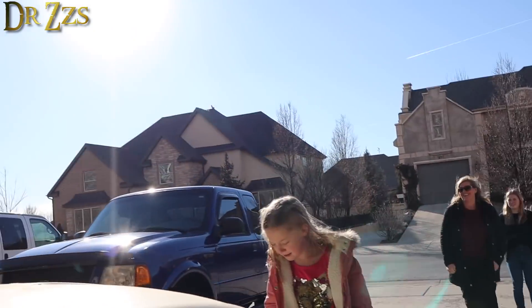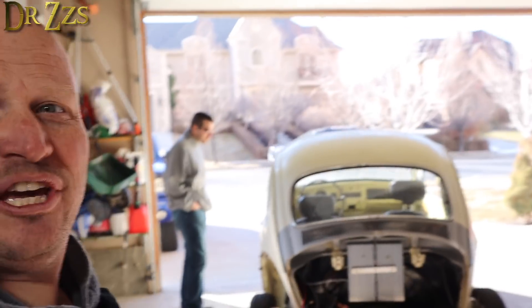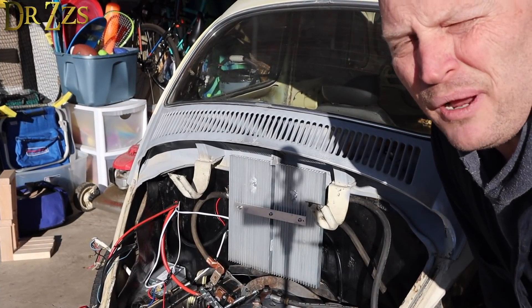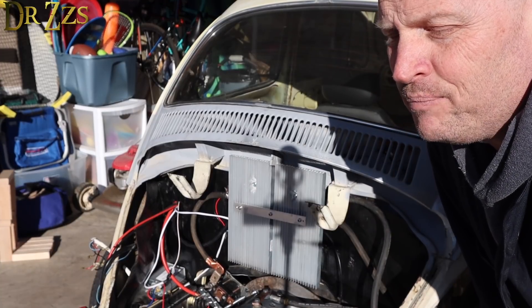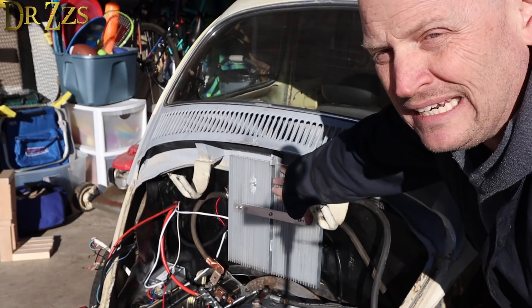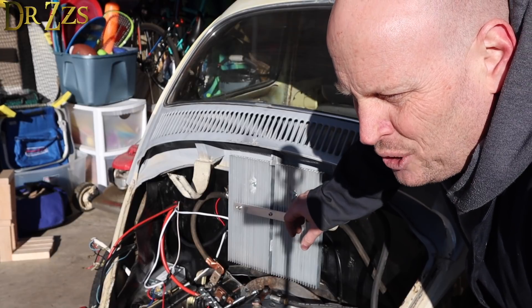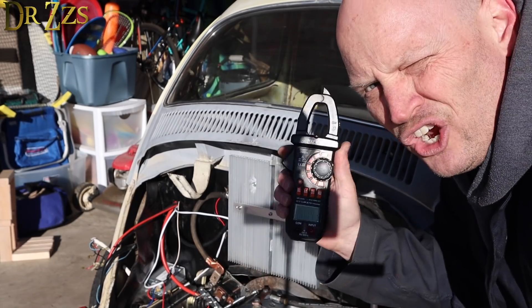And it didn't explode. We did it. So, I am concerned about how slow it was — it was not fast enough at all. In fourth gear it really couldn't get going, and in third gear it got going but we only got up to about 15 miles an hour. I have an assumption about what the problem is with the speed. The motor controller has a current limiter. I think the weight of the car has increased the demand of the motor enough that it's reaching the current limit of the motor controller. So I'm going to take the motor controller off, play with that dial on the current limiter, try and just turn it up all the way and give it another run. We also have an amp meter to test and see what the current draw actually is.